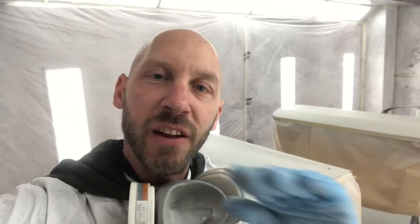Okay, so we've got epoxy on the doors. They look nice, they look straight. Now, we're gonna hit it with a black primer. Normally we'd use a filler primer to put it on really nice and thick to cover any repairs, and then we can block it afterwards. But because we've already used a polyester spray filler and a lot of the repairs are, say, 80 to 90% there, I'm gonna put the primer on a little bit thinner, a little bit wetter, and let it flow out a bit. Then we won't have to go quite so hard when blocking it. We can probably get away with just a 600 or an 800 block rather than like a 240 or a 320 first. All right, let's hit it.